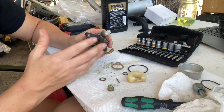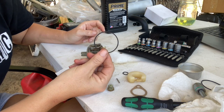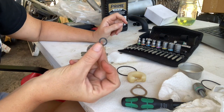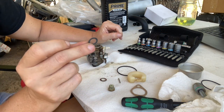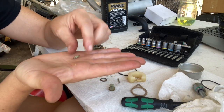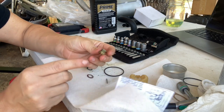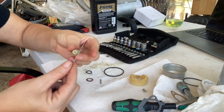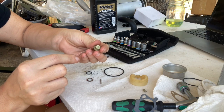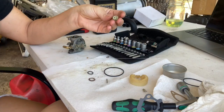On the other side — the one that goes against the air filter base — the bowl gasket is part number 797625. The bowl nut gasket is 797632, and the needle number is 797139. The first thing we're going to do is take this main jet — it's the bowl nut main jet — and clean it out. I'm going to spray it real good and then use a guitar string to poke through the holes and make sure everything's clean.